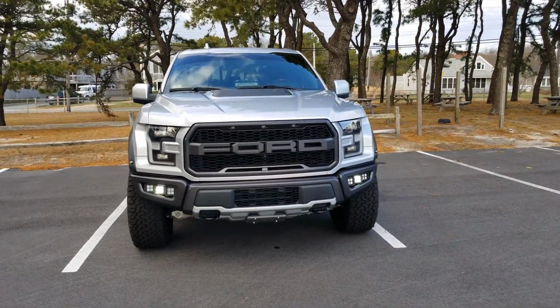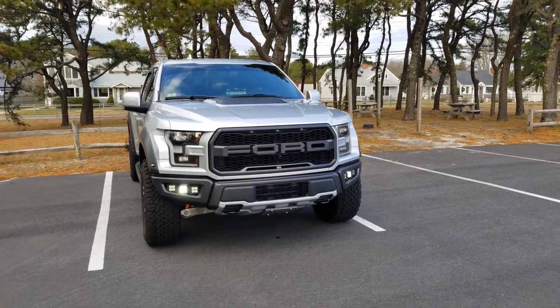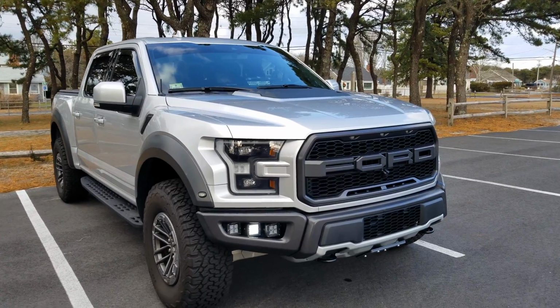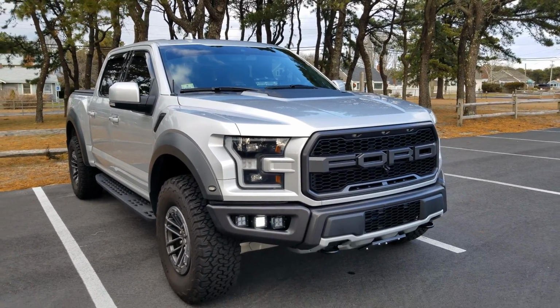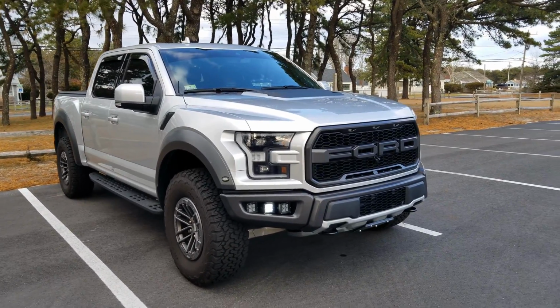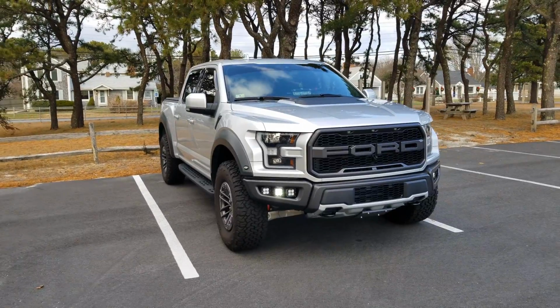The fog lights provide good short-range light coverage as well as off-axis coverage, while the high beam is definitely for more longer projected range. The reason why Ford does this is because they have 2 separate bulbs for high beam and low beam. Some states require that you can only have a maximum of 4 forward-facing white lights on any vehicle, and that means that if Ford turns on your high beams, then they have to disengage the fog lights to be able to match that 4 count.